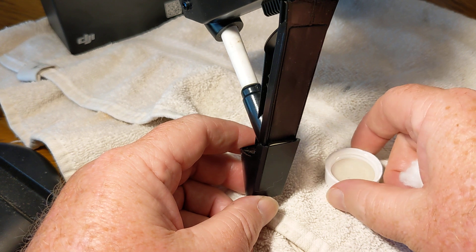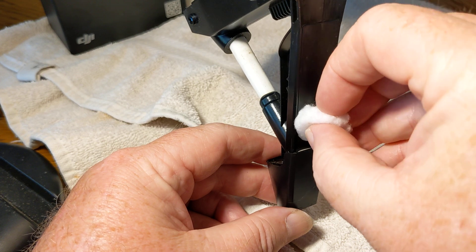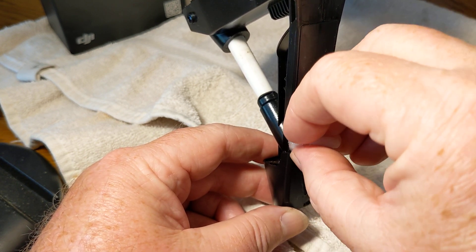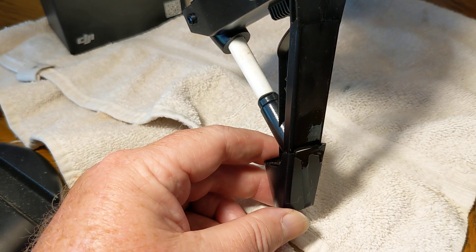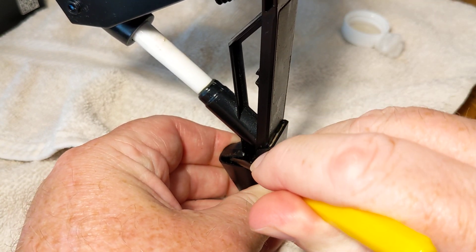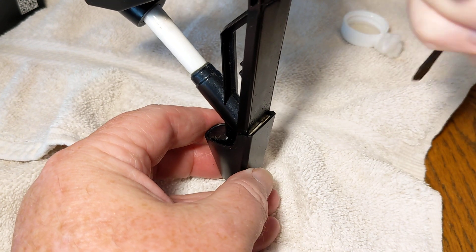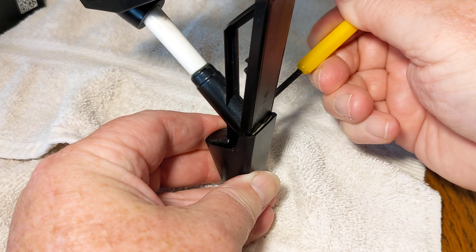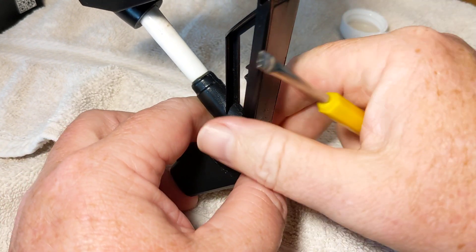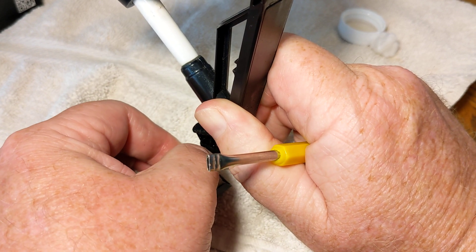So here I've got a little bit of rubbing alcohol on a cotton ball, just soaking it in the rubbing alcohol and letting that rubbing alcohol go down to where that sticky pad is. It softens the adhesive and allows you to get the riser off the bottom of the foot. With that soaked in there I'm using this tool to just pry the riser down off that foot and it will come off. I'm trying to be cautious not to pull down on the leg because up at the top the only thing holding it together is one single wire — I don't want to pull that. That wire needs to be preserved because it connects to the antenna which will need to be reconnected after this, and it's not a wire you want to snip off because you need every bit of length that wire gives you.